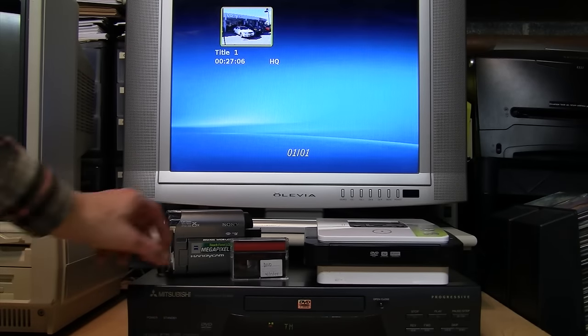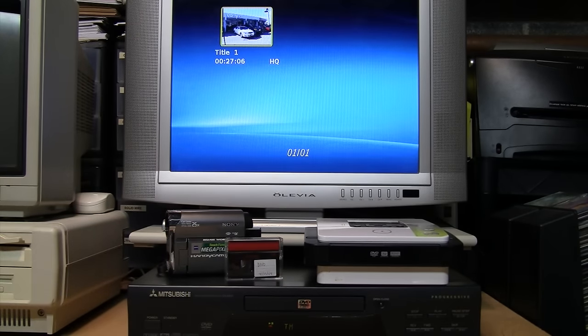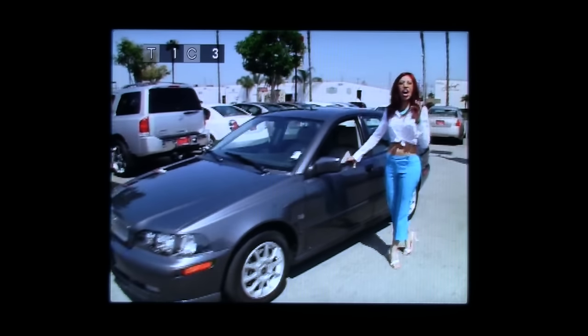When copying video from DV tapes, you get one title per tape on the disc. It does not automatically split them up according to the dates that the video clips were originally recorded. But it can optionally create automatic chapter markers at 5, 10, or 15 minute increments, which does make it easier to find approximately the part of the tape that you want to watch after it's been copied to DVD.